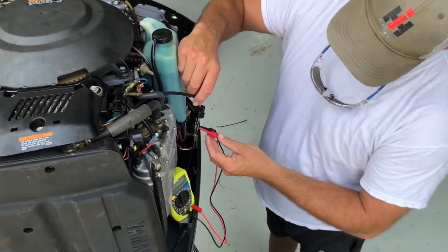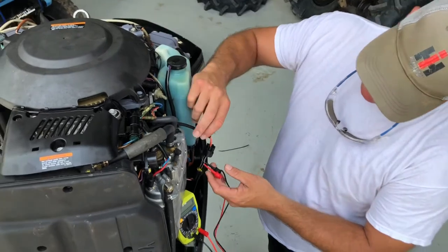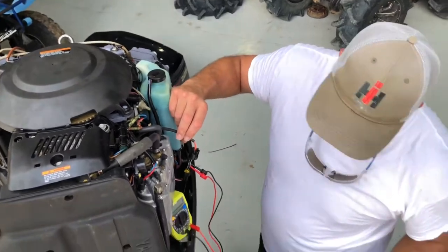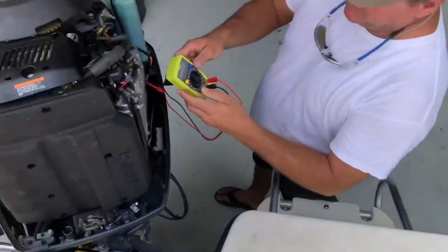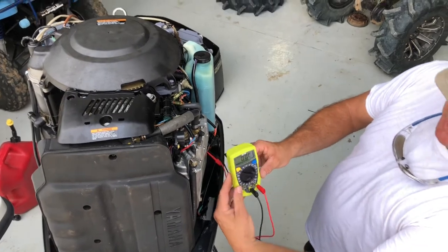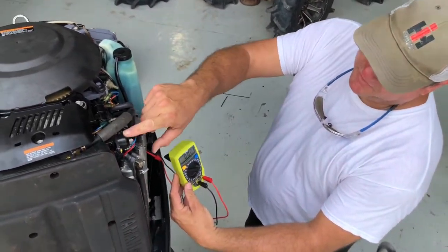What I've done is I've got my probe wires — the ones that connect on — and we're going to probe the orange wire and the pink wire. That's what the book says we need to go after. So we'll turn our meter on — volts DC is showing zero.